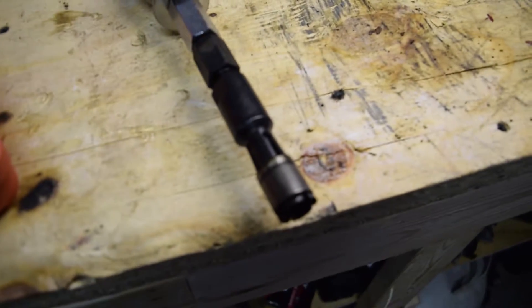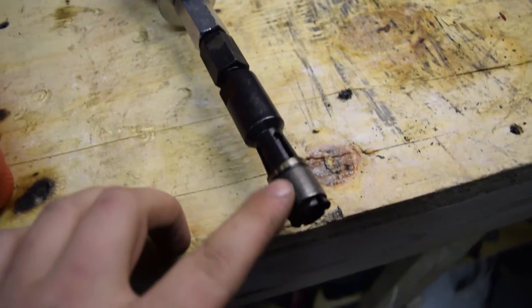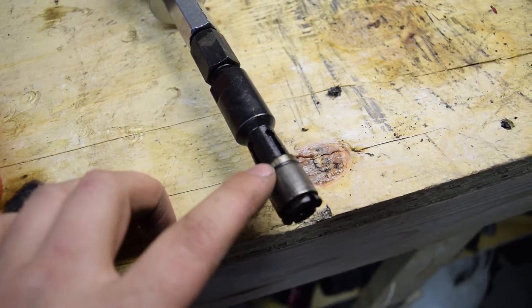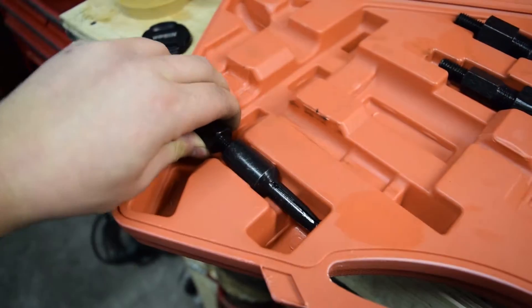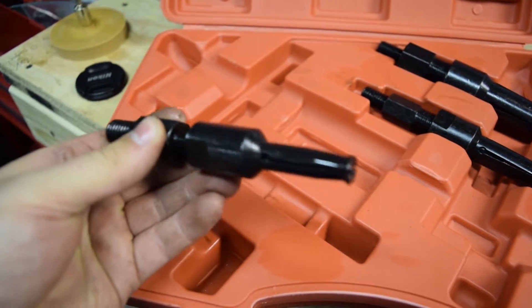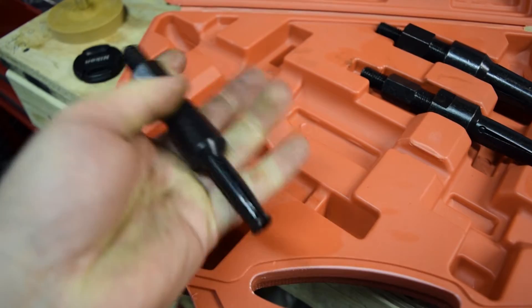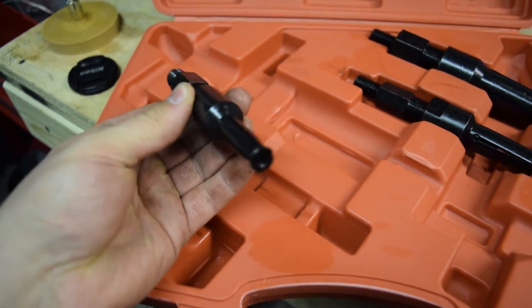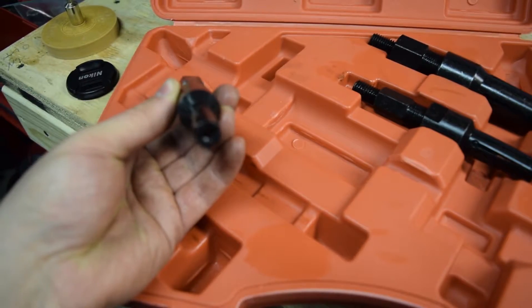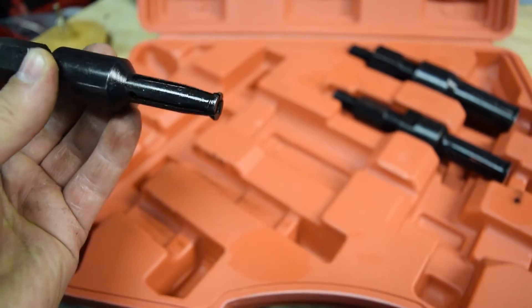What you do here, as you can see, we've got the pilot bearing on the bottom and the pilot bearing seal on the top. It comes with four options. The smallest one would have fit in there, but the expansion you would have had to do on the bottom here — tighten this down and it expands these three legs out — the expansion would have been way too much stress at the end of the shaft.